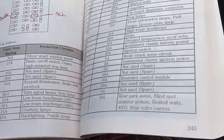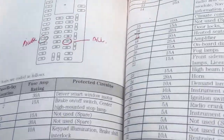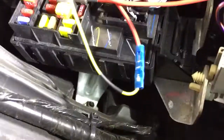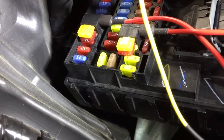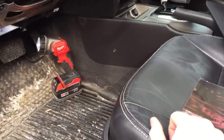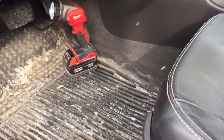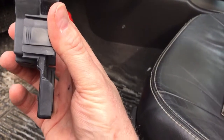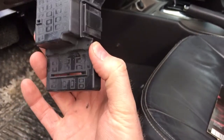For my accessory, I picked number 37, which was actually a spare. I tested it to make sure that it was only on in the accessory position and put a tap in for that. So there's the two fuse tabs. Ford made these interior fuse boxes just the most ignorant, un-user-friendly place to put a fuse box. What I had to do is take the cover — and I know it doesn't look too nice, it's kind of cold out right now so the plastic was a little bit brittle — but I cut a little notch in the side so that those new wires can pass through.